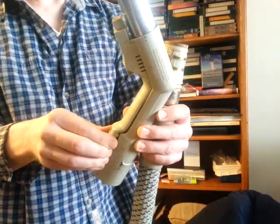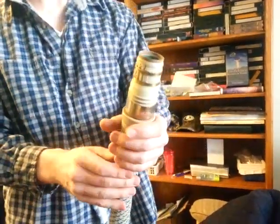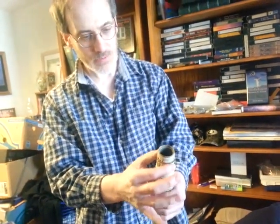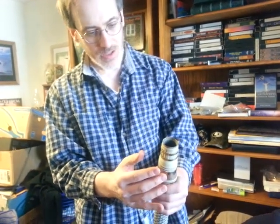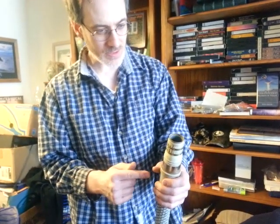You've got to kind of get your fingers out. Now if it was still hooked up to the vacuum on the other end, these two rings around here are powered with electricity for the power nozzle, and if you turn the vacuum on, those will be live. So you've got to watch that while you have this all taken apart.